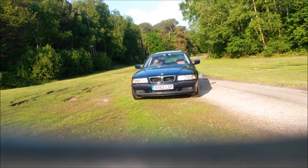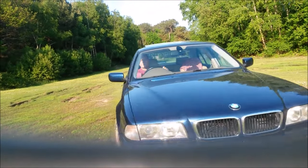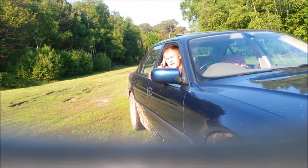So before you get back on the road, test your brakes. Don't make any sharp turns until all of the mud has gone off the tyres, and top up the tyres if necessary with air. Happy and safe motoring.